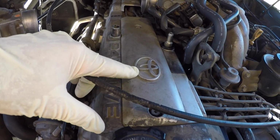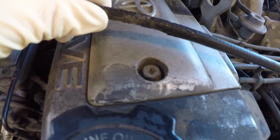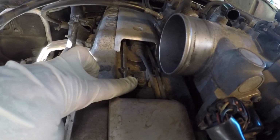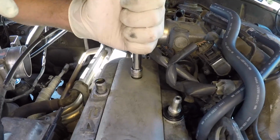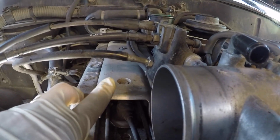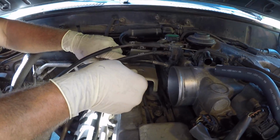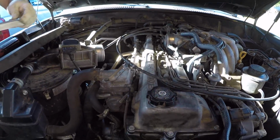The spark plug wires live right underneath a front cover and a rear cover, and they're held on by these little 10mm bolts. So Aaron's just going to get on there with my Milwaukee and zip out 2 bolts for the front cover and 2 bolts for the rear cover, and we're going to be able to expose more of the spark plug wires that run along the top of the valve cover. This transmission kickdown cable is getting in the way of a straight shot, so we're going to try to get underneath it with a 1/4" ratchet and see how that works. There we go. Okay, the back cover is coming off, and then we'll get the front cover off. Okay, both covers are off.